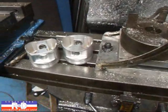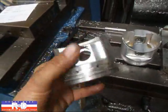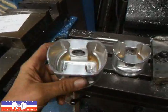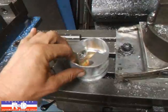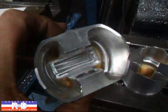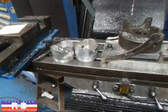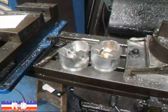Hi, it's John of Costa Mesa R&D. Today we're over here at the mill and we've had a customer bring a set of pistons in for a Volkswagen off-road race vehicle, and we've been asked to lighten these up. We started by taking off a little edge on the piston and then milled out the area inside. The minimum weight target is 315 grams and we've been able to get it right down to 315.2 grams, so we're in the hunt.